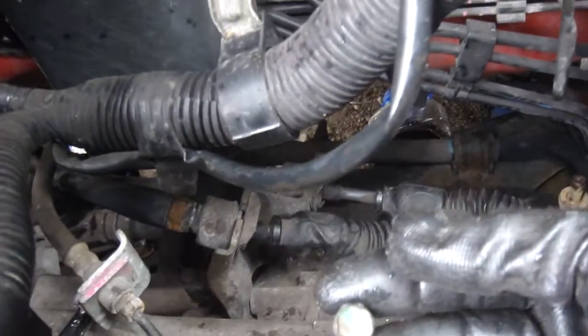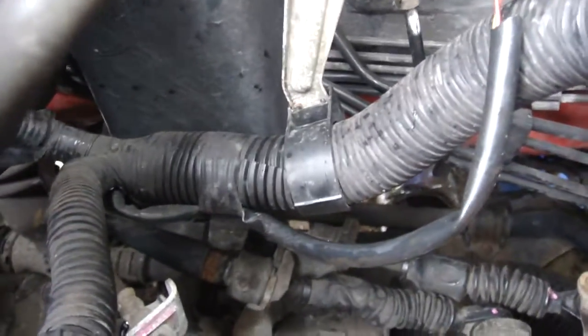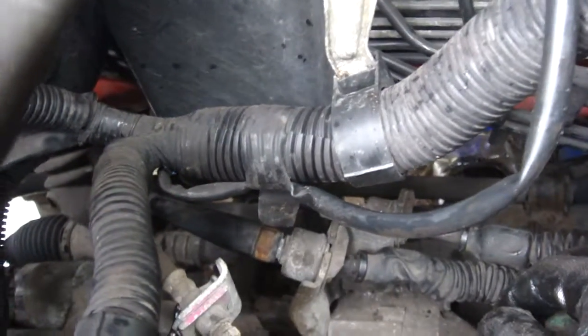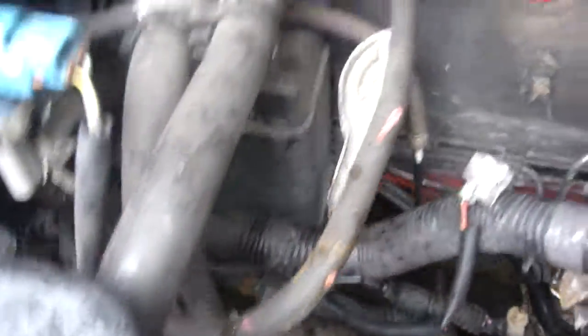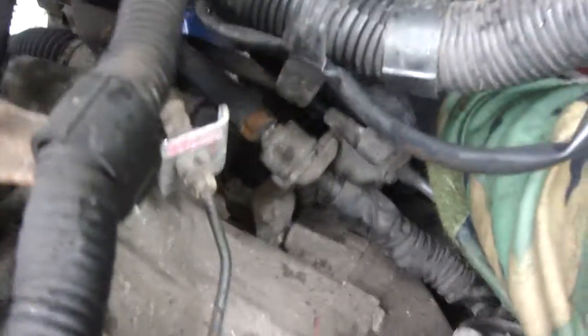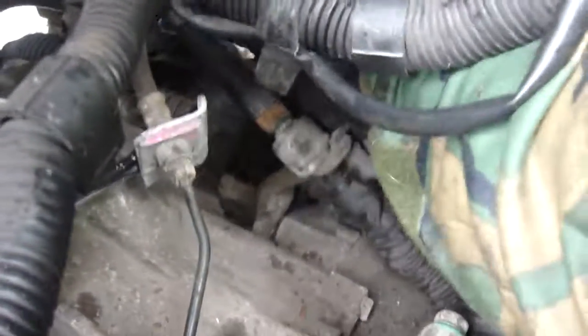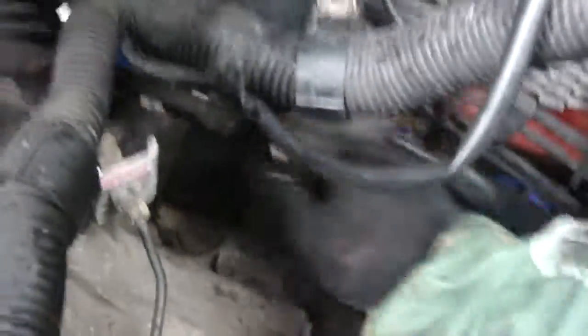On this particular car they chose to use 12mm bolts and 14mm bolts for the top - 12s and 14s really. They're a bit tricky to get to. This is why I like to use a quarter drive set rather than a 3/8 drive set, because with a 3/8 drive ratchet it's too big to get down there. With a spanner or a quarter drive ratchet with a 14mm socket, you need to feed your hands down the back of here. There are three bolts holding that on, and once you've taken them off - which you can get to from the top of the car - that moves out of the way and you can get your gear linkages out of the way.